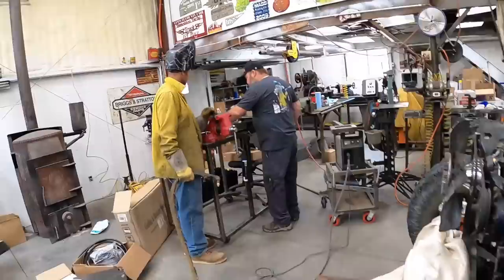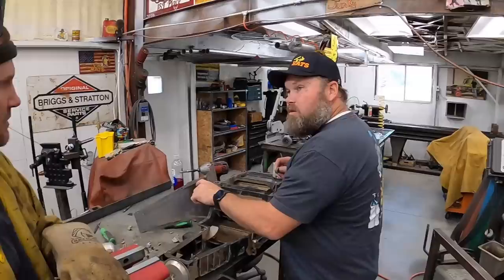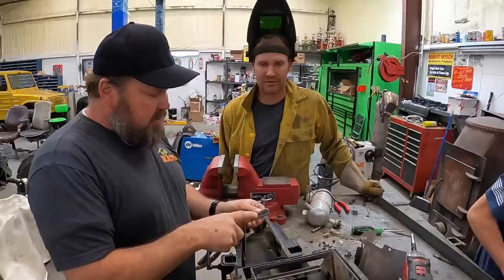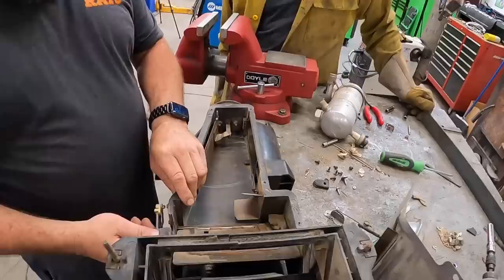This is plugged here. Goes right here. Because there's a vacuum line that's supposed to go right here. It wasn't hooked up, so it will be. Problem is our little piece here. We gotta drill a different hole in it so we'll fix it right, and then it will travel the whole distance. Right now it's only going middle of the road maxed out, so we're never shutting the heater off.